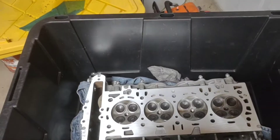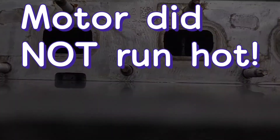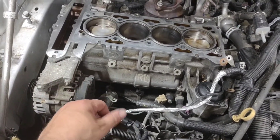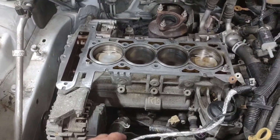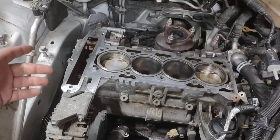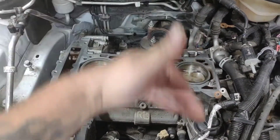A little tip on why you should always get it decked — I'll put a video right here on why you need to. If you did have head problems and need to rework your heads, lap them in or check them, I got two other videos showing how to do that on my channel. But now we're at this part — I'm going to go ahead and put the head back on and then start working on the chains. I got all new chains and sprockets for everything.